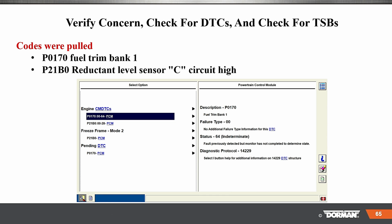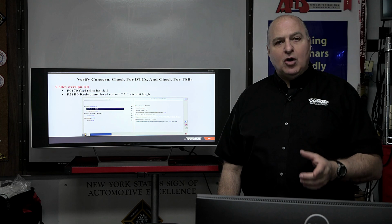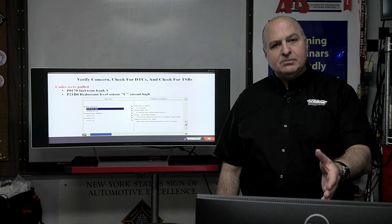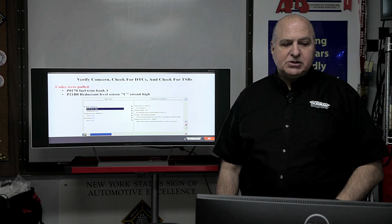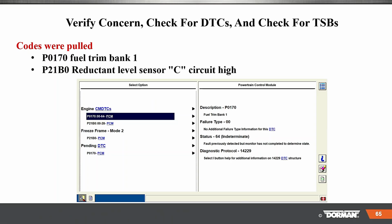Open. Oh, very good. So Dirk, an open, I think his name was Dirk, right? Yep. Yes. An open, very, very good. Write that down if you don't know that, because that's important. Circuit low, usually a short, nine out of ten times. Circuit high is going to be an open, right? So open is high and shorted is low.